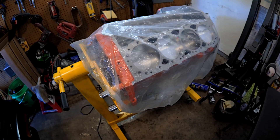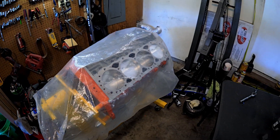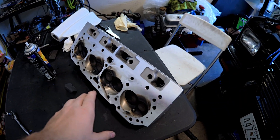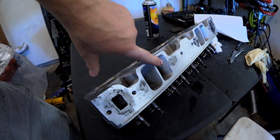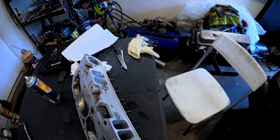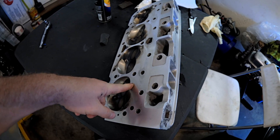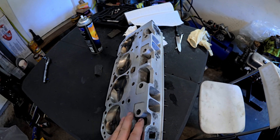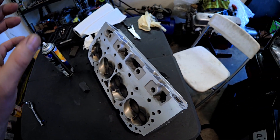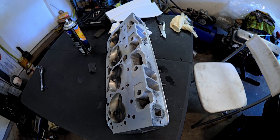I did put on the oil pan and I'm getting to these heads right here. I've got to clean this one up — you can see there's residue here. I had to pull the gasket off. I don't reuse gaskets. If you're one of those guys that uses a little wheel on there, I just don't do that. I think it takes off too much material, especially on the aluminum side. You've got to be very careful — after all, this is a machined surface. Being very gentle with your cleaning is more important than just zipping it off.